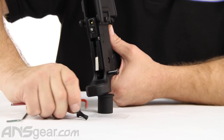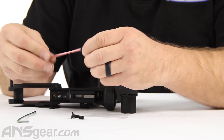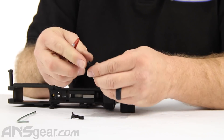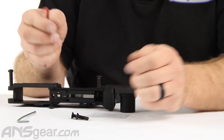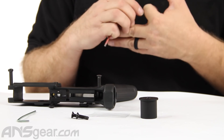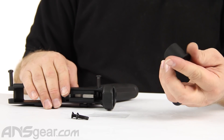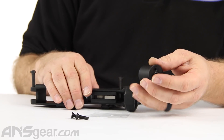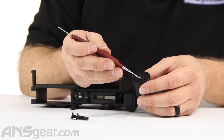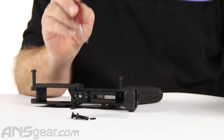We will be reusing them. You can go ahead and clean them off — take a towel and run the screw through it like that to clean off any excess Loctite. They don't use a lot and you don't need a lot, but it does recommend to reapply it when we go to put it together. So we've got our tank adapter off. The instructions say set the screws aside because you're going to use them, and remove the O-ring because you're going to use it — which is true, you will be reusing the screws and the O-ring.